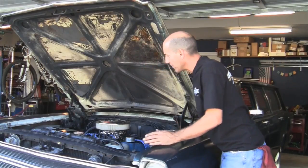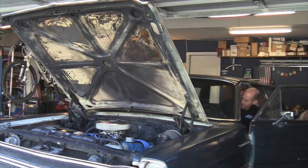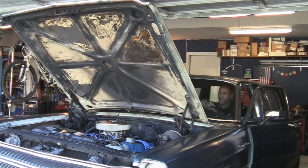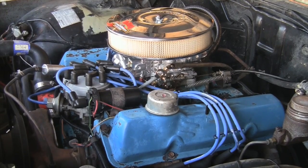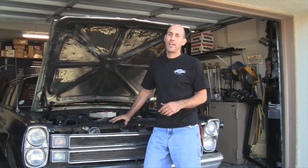I'll double check it and we'll fire it up. Everything looks great in here, not a single leak, so now let's try to fire it and see what happens. Once the engine is running, check the sight glass on the sides of the float bowls to make sure the fuel level is correct. Holley recommends just below halfway on the glass, and this looks pretty good to me. And there you have it — a carb swap, as simple as that. Now I haven't put a screwdriver to a single adjustment on this thing. I'll drive it around and see if it needs a little timing adjustment, but right out of the box I can tell right now it's going to be night and day better.